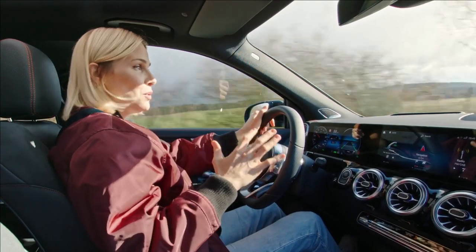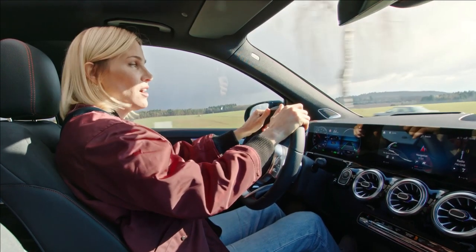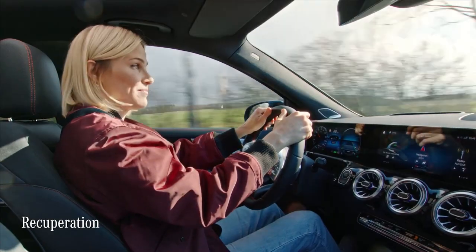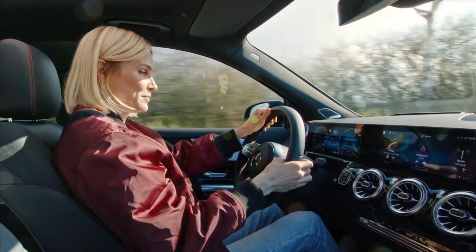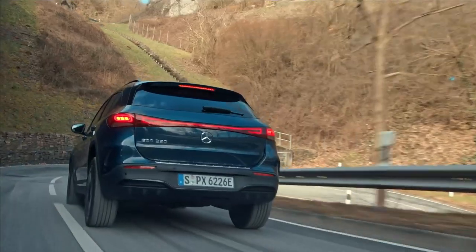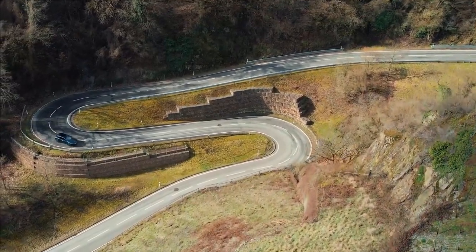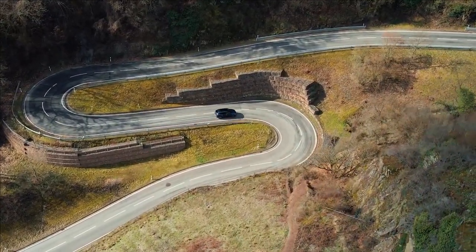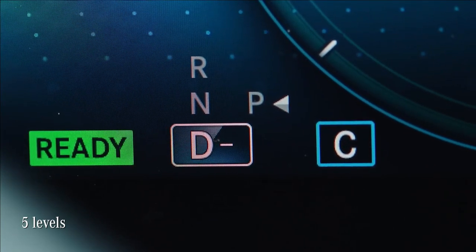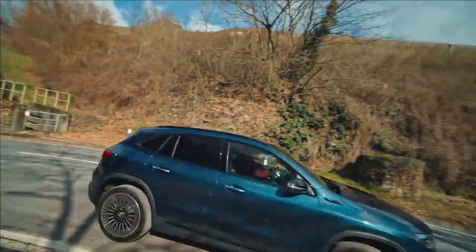My favorite magic trick of this very clever car is called Recuperation — you can win back energy. When braking or slowing down, the electric motor generates energy which is then fed back into the battery. The five recuperation levels, from rather strong to rather light, are tailored for situations from steep downhills to city driving.